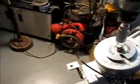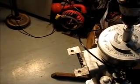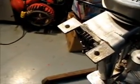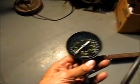Into here, and we can spin this thing up a few times and see how it rotates, and we'll put our compression gauge in there as well. By the way, I don't like doing this dry cylinder, so I'll put a couple of squirts of old 3-in-1 into the cylinder just so that it's not dry. Now this is the standard head. Have a look here. And that just says 0. It's all been zeroed out.